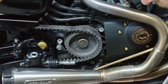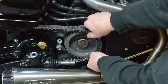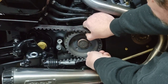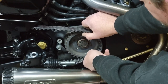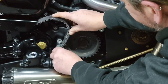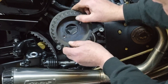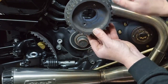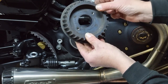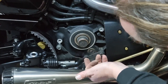The hard bit's done. The rest should be absolutely easy. We've got a little bit of slack on the belt now. We'll put the bike on the jack and readjust the rear wheel once we've done the switch. The pulley comes off nice and easy — just inspect the splines on the pulley once it's off, make sure everything's okay. And now we've got that off, we can see and get at the neutral switch.